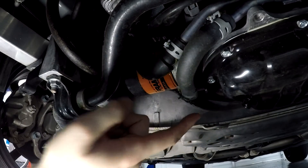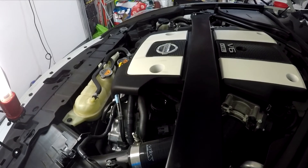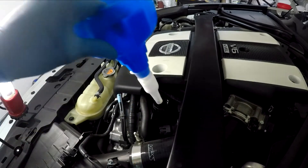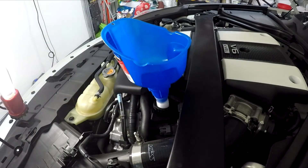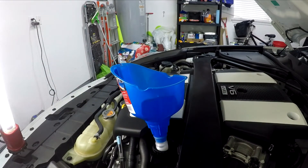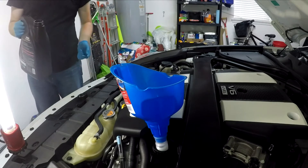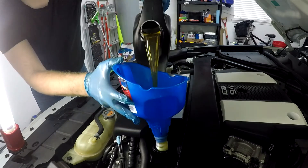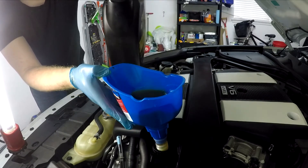So that's the filter replaced and the drain plug put back in. Now it's time to go back to the top of the car and pour in our new oil. Stick your funnel inside the oil filler opening so that it's easier to pour the oil in, and then grab your oil. This car takes a little over five quarts — I'm only going to pour in about four of them to start with, and then I'm going to check the oil level as I go, because I don't want to put too much or too little. You want to do this kind of slowly — you don't want your funnel to overfill, as it takes some time for the oil to seep in.